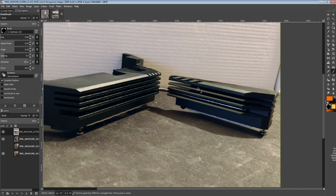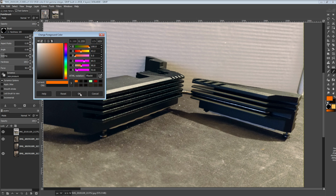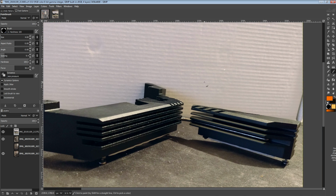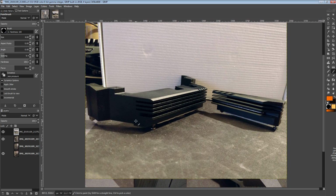So this heatsink handles 4 of the V-core phases and 2 of the SoC phases. This heatsink is probably going to be dealing with a lot less heat from the actual power stages under it. So if this heatsink ends up warmer than this one, it'll just start putting heat into this one, or the other way around, right? I might be completely wrong with my expectations of this heatsink running coolest, but I think this one generally runs coolest. So the heat pipe is basically there to add extra heat capacity to whichever heatsink is losing in its battle against the heat output of the VRM. Yeah, that's kind of that.